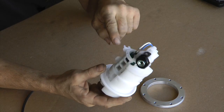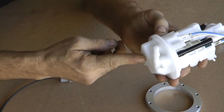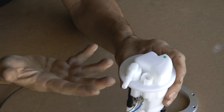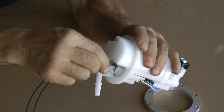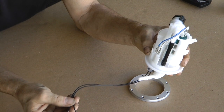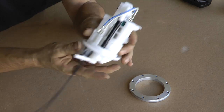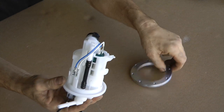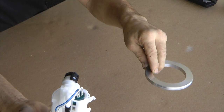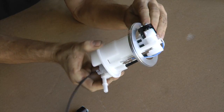The regulator is built in. The fuel pump motor is built in, positive and negative. The filter to filter fuel prior to going through the pump is part of it, at the lowest part of the pump. It's easy to make a connection to the system because it's supplied with a pigtail that just wires up to your battery. The amperage consumption is much lower — 1.6 amps versus 6 to 8 amps per pump. You can have one in each fuel tank; the flange can be welded to the bottom of an aluminum tank, a header tank, or bonded into a composite or aluminum tank.